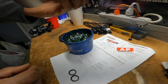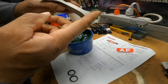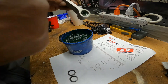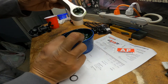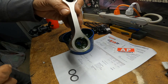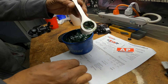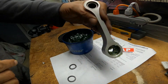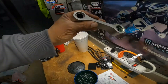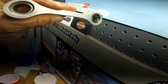Be careful not to disturb those needle bearings. What's going to happen is when you put the bushing back through, it's going to push this grease through the assembly. Just put a little bit on the mouth like that. I'm not going to stick my finger in there and try to coat those needle bearings because they could easily stick to your finger and come out. You don't want to do that — if you can avoid it — because you will quite possibly screw your bearings up and then you're going to have to one by one, painstakingly get each one of those little suckers back in its place. Nothing you want to do if you don't have to.